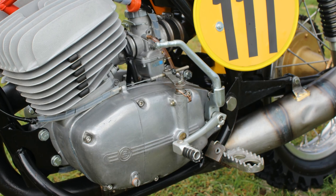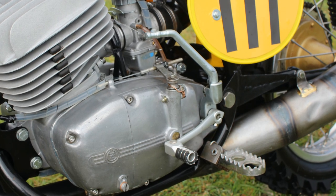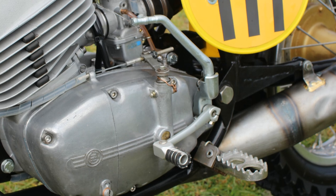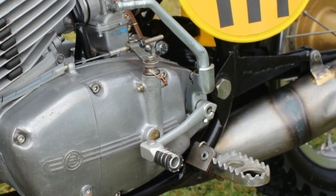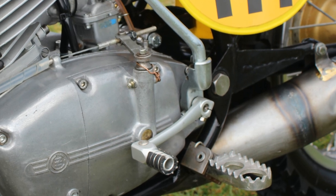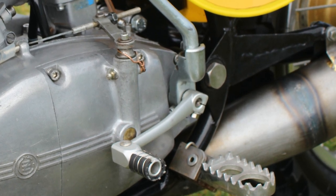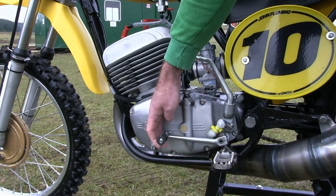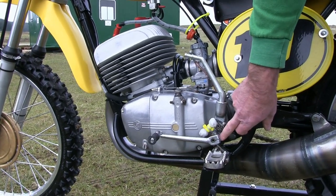When it comes to the gear shifters on these CZs, they were quite well known for the long throw of the shifter — often you'd have to physically lift your foot fully off the pegs to engage the next gear. Although you don't see it in these pictures, John sometime later fitted a brand new conversion prototype which used a simple variation of knuckles and rods to eliminate that excess movement on the side of the engine, and in this clip we can see John demonstrating exactly how it all works.